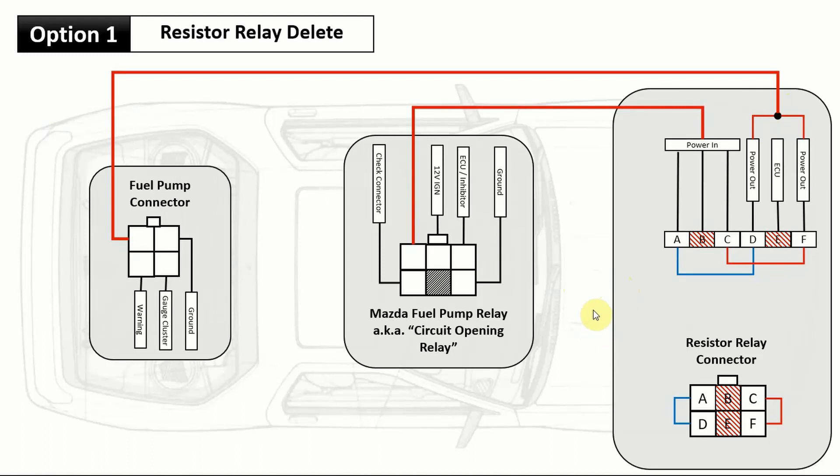This is by far the easiest way to do it — you don't have to remove any interior. You just need to solder or crimp a couple of wires together. The one thing I don't like about this is the excess wiring running from the fuel pump relay under the dash all the way to the front of the car under the passenger headlight, then all the way back to the fuel pump. About a year ago I made a video showing as much as a half-volt drop over that distance — I'll put a link below. That's option one.